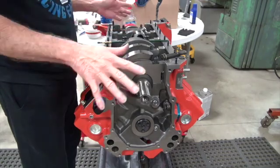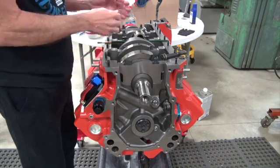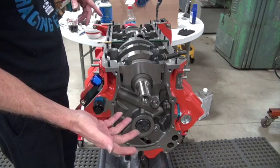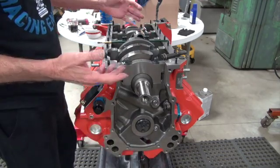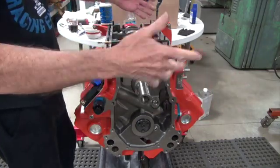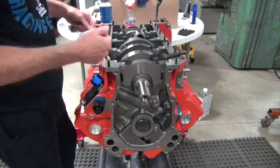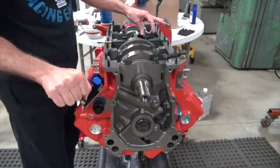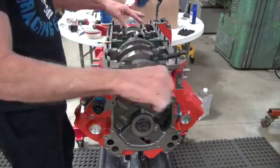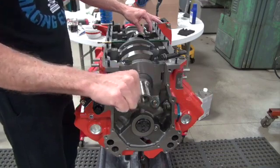You want to do it in 3 even steps. Like on this, you would probably want to torque it to 50, torque it to 80, torque it to 110. The reason is if you randomly tighten this up and then decide to go to 110, you might have got that to 100 already. The breakaway torque, if it was torqued to 100, is liable to be 110, so your torque wrench is going to click before you even turn it, and you haven't got it at 110. You have to have a smooth pull till it clicks or beeps or whatever your torque wrench does. You can't get close to your number and then try to torque it to spec. So if you take it to 80, that gives you nice room to get a pull on it until you get the click.